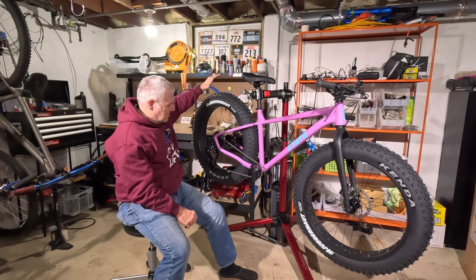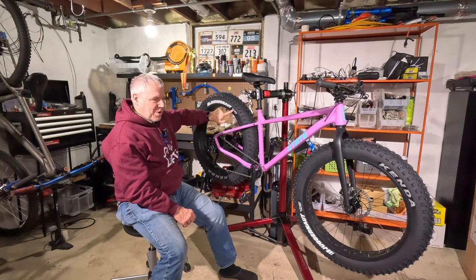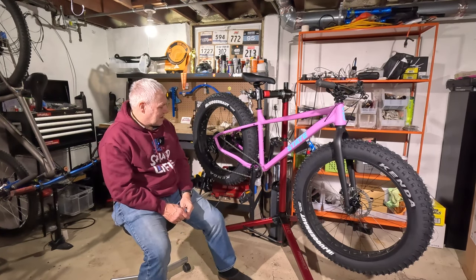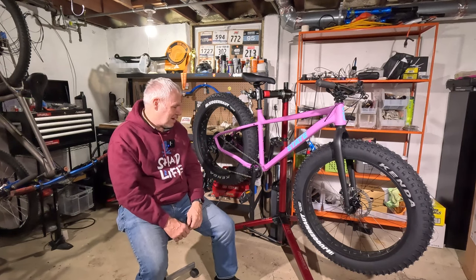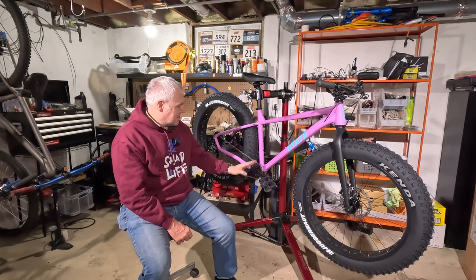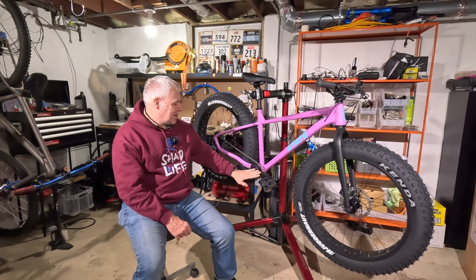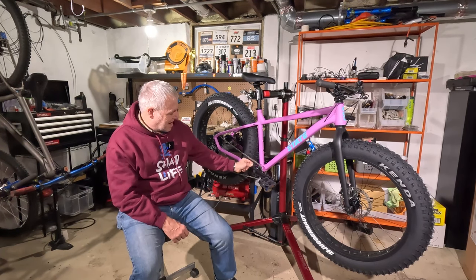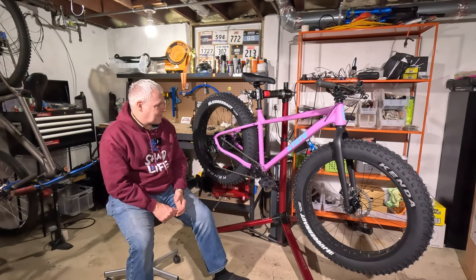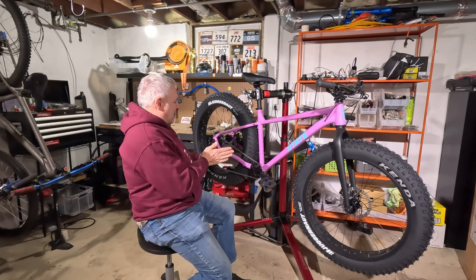Almost 40 pounds — that's a heavy bike. I believe a lot of that weight is in the tires. You could shave two to three pounds just by upgrading to a 60 or even 120 TPI casing folding bead tire, which would suddenly make it feel much snappier. The crankset is another place to shave weight — I can tell it's cast heavy aluminum with a heavy bottom bracket and steel chainring, so there's probably a lot of weight there you could easily remove.